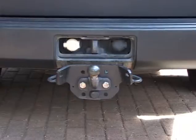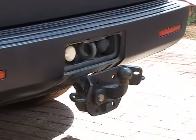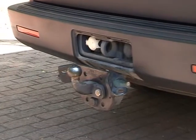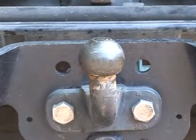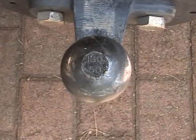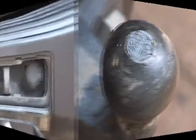The tow vehicle must be professionally fitted with a properly designed and high-quality SABS-approved tow bracket. This will make a difference in towing and safety, and its importance cannot be overstressed. The coupling fitted to the caravan hitch will accept only a 50mm diameter ball. Do not try to use a ball of any other size. Check that the one being used has a 50mm stamp on it.